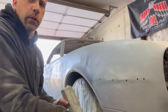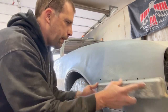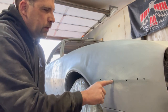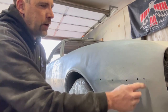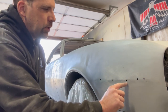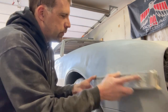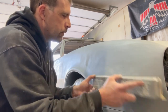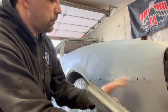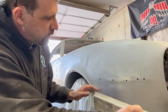Alright, I'm starting to see low spots coming through. Now that line is supposed to be just below these holes — these three holes where the Firebird badge goes on. That line is supposed to come into the fender just below these holes. Right now it's kind of showing up almost above. I'm going to have to work this out. I'm just cutting the primer off, basically opening the face of that up a little bit to see where we're at, and it's not looking too bad.